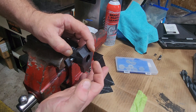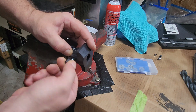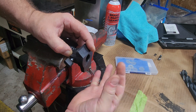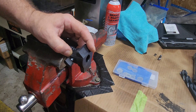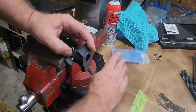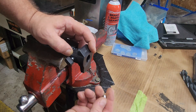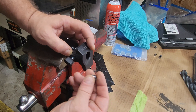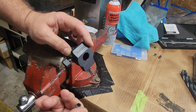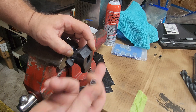I had the diamond cutter spaced just right to where my line was on the pushrod, tightened it down, then put the pushrod right up against it and gently spun it. At first it made a good cut for about three seconds, and then that blade was done. What was happening was the pushrod was getting hot and melting the disc. It wasn't the Dremel's fault, it wasn't the attachment — the blade just didn't cut it.